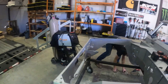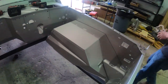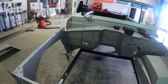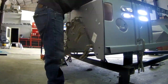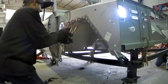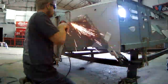You guys are probably thinking the only one ever on camera doing stuff is Chris! I'll get this clamped up — got another one sitting over there to get clamped down as well. Here we go on the passenger side, the last side — we're almost finished. I'm going to spot weld every other hole, adjust those clamps, then finish welding. Chris is going to come back through and grind it all up — and that's how the whole front clip is put together.